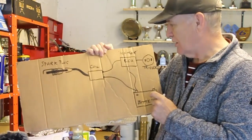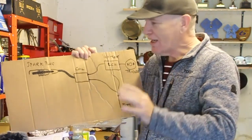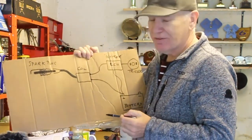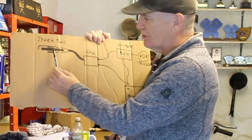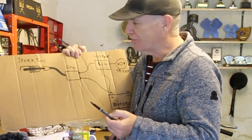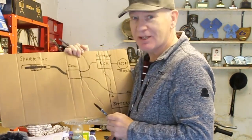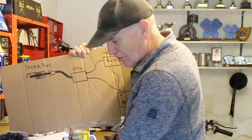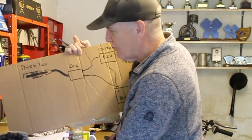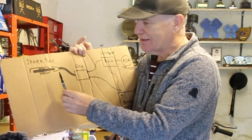So that's the basic system. Let's go back to the humble spark plug and talk about that. The spark plug is made up of three components. First, you've got this long thin central rod made from a conductive material. You've then got an insulator around it, which is often ceramic — that's the bit you can see sticking out of your engine, which on this spark plug here is a slightly yellow colour at the top. Then the third component is the part you screw into your engine — it has a thread and a hex fitting to let you screw it in.